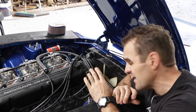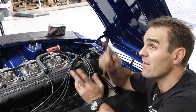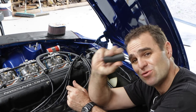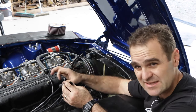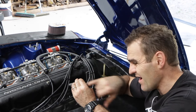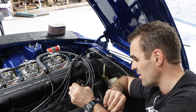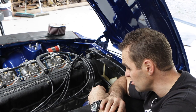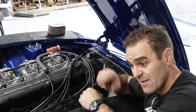The issue I'm having is that it's just too bright in here for the colour tune. I'm going to wait until night. I've got these skylights and it's too hard to see. I even cut out a piece of old heater tube and stuck it over the top of the colour tune — the more modern ones come with a long plastic tube that goes over the top to shield it so you can see inside. I can see the spark but I can't really see the colour very well. I think night time is the time to do this properly. For now I'm going to refit the filters and then start moving back inside the car.